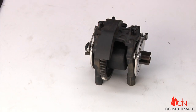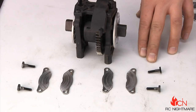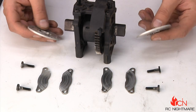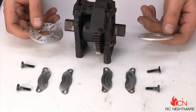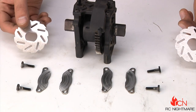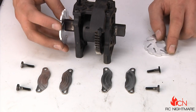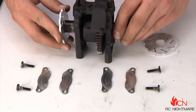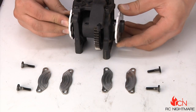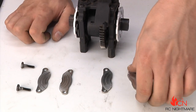I've removed the brake pad pins and pads using a 10mm socket, and now we can just slide the old rotors off. These stock discs are just stamped metal — not a whole lot of cooling slots. Comparing them to our nice shiny laser-cut Bartolone brake discs, we're gonna pop these on. Nice tight fit because they're brand new.